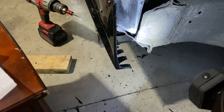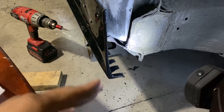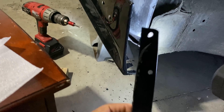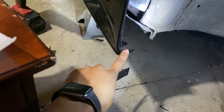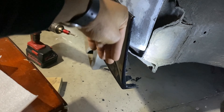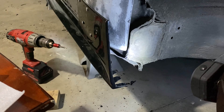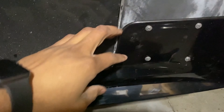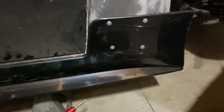What I did is I found this curve right here and right before it starts to curve I put these two self-tappers, and two more back here for added rigidity. Now I'm going to take one heat gun on the backside and another on the front side. Once I see this start to warp I'm going to start pushing it around this curve. Before trying to warp this I made a few relief cuts on the bottom — went straight and then at an angle and cut through. I also took off this piece which angles down, since I'm trying to get this side to curve over. Side note: make sure the side skirt doesn't get in the way, because if this part lines up everything else will line up.